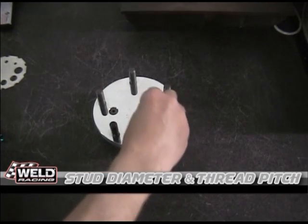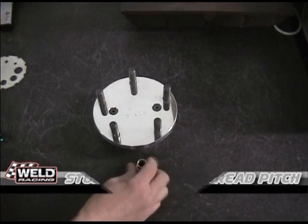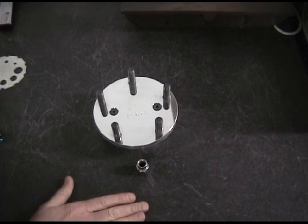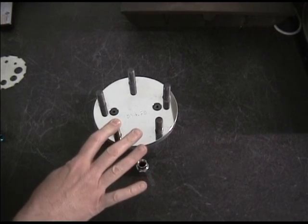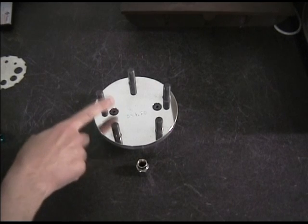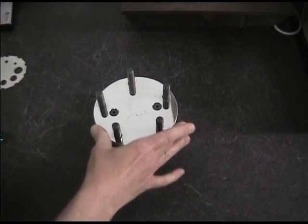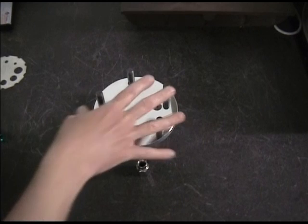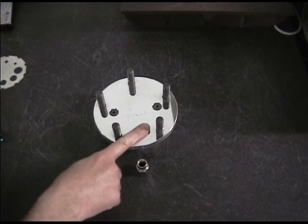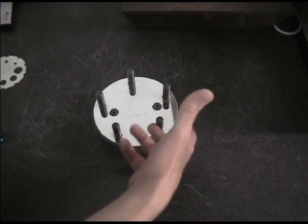Obviously, the end result is you want your lug nut to screw correctly onto the wheel stud. But before we talk about thread pitch and diameter, let's talk about what studs do on a wheel. Wheel studs are designed to clamp the wheel to the vehicle. This device here is a piece from one of our show rigs, serving today as our mounting flange, showing the stud location and wheel face location. What a stud does is clamp the wheel to this surface so that the surface friction between the wheel and the mounting face actually drives the wheel. The stud is designed not to be in shear, but always to be in tension — in other words, clamping only.